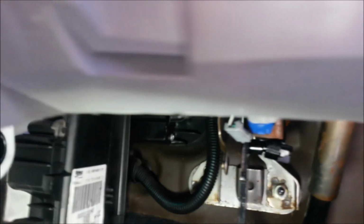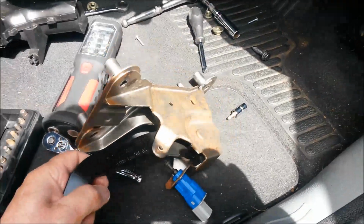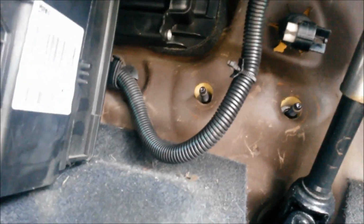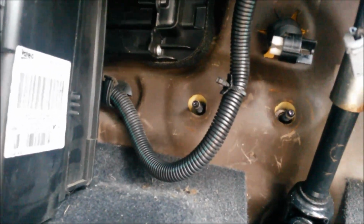So I'm just going to take out this clutch now. Just ping out the cable clips, undo 3 13mm securing bolts, and pop out the master cylinder linkage with the 3-finger prong thing, where you can do it with your 3 fingers to pop it out. So I'm just going to do that now. Okay, there's the clutch pedal removed out of the way. You see just the 3 studs sticking out. The clutch master cylinder linkage just disconnected. It's just a pop fit back in.